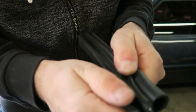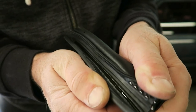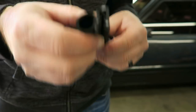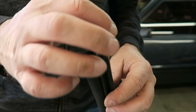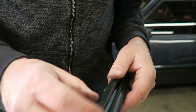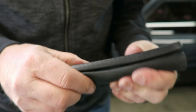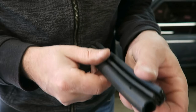You can actually see there's shiny glue in the bottom of it, so it's going to kind of seal that thing up. The fact that it has steel reinforcement means when you push it onto the pinch weld, it holds itself really well — no glue needed. And in the corners, the non-reinforced style will want to fold out, and this stuff doesn't. Just a quick tip: spend the extra ten bucks and get the good stuff.